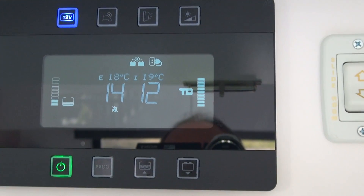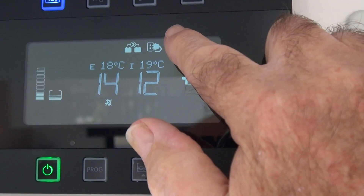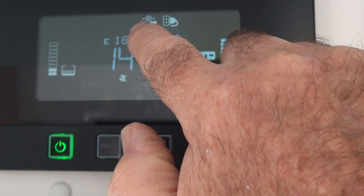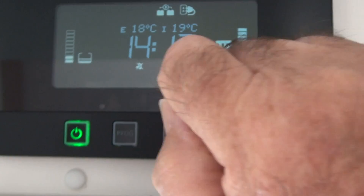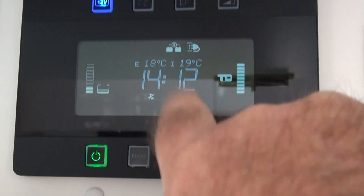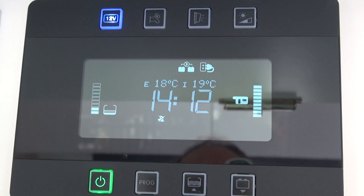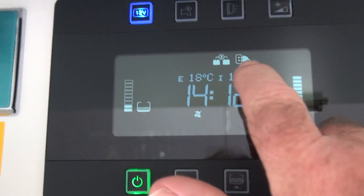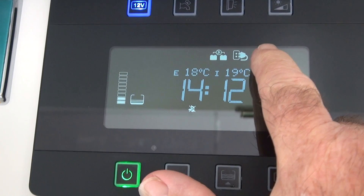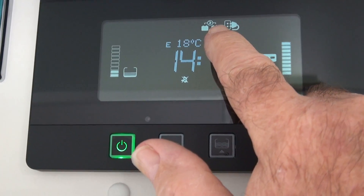I just want to show you a little thing here. With plugged in, we've got green lights everywhere, we've got 240 volts. This symbol here tells you we're plugged into power, and this one says we're charging the batteries — both house batteries and everything. When you get the engine on on the Fiat, it'll tell you that it's charging as well. You can see that if you get in the motorhome and something goes wrong, this panel tells you the status straight away — whether you've got 240 coming in, or if somebody's taken your plug out, or there's been a power blackout and you need to take steps to restore power.